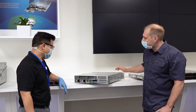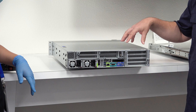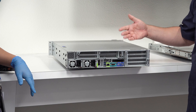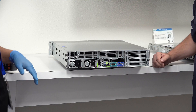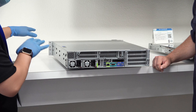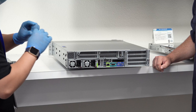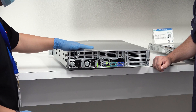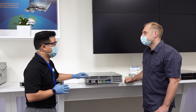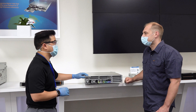One of the other cool features is that a lot of customers are actually putting Intel N3000 FPGAs into these slots — they're dual-width slots that can handle higher power cards. The 2U form factor has a better airflow design, and with six front-loaded heavy-duty fans, it has a more efficient airflow design because of the reduced chassis depth. You can accommodate FPGAs, two dual-width GPUs, as well as a variety of networking cards and storage options.